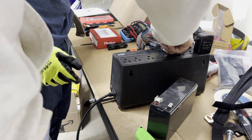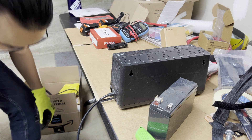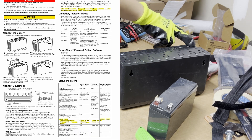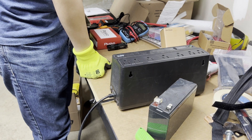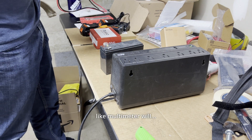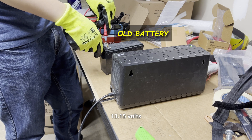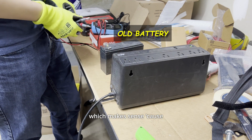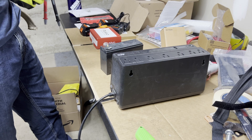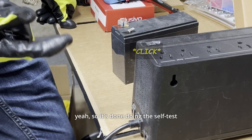So can you turn this thing off? Yeah. Are you holding it? That's how I got rid of the beep when it would beep — there's an icon here for silencing it. I thought just a tap would do it. Usually it does, because I think it would beep multiple times, and then I would just tap it into silence. But with this one, whenever you turn it on, it would just beep when you had that battery installed. So do you actually want to try multimetering this to see why it's beeping with that? The multimeter will probably say it's fully charged, but the capacity is probably super dead — and that's how the UPS can tell; it probably does a power-on self test. So this one says 13.15 volts — actually higher charge than the new one, which makes sense because this one's been charging all the time. When you turn it on and it's flashing the first few seconds, that's because it's doing a self test. Right after it does the self test with the previous battery, we start beeping. You'll probably hear a relay click when it's done — so it's done doing the self test.